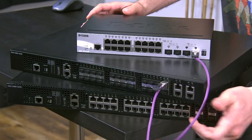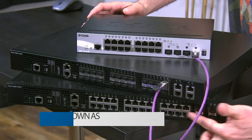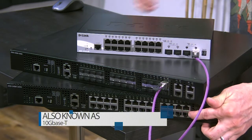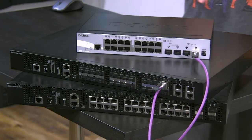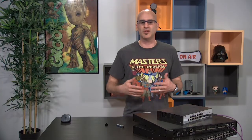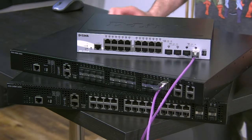We've also got copper connections as well. These ports on this switch are 10 gig over copper — the same speed, but using a different cable. Those cables can sometimes be more expensive because they're using thicker copper, and they have some distance limitations, whereas fiber can go much longer. So when you're deciding on your switch, look at the distances between all the sources and the devices you're using to decide whether you can use SFPs, copper, or these pre-built Direct Attach Copper cables.